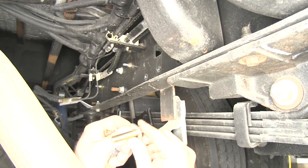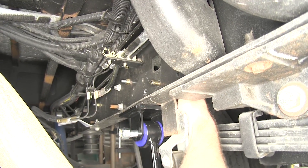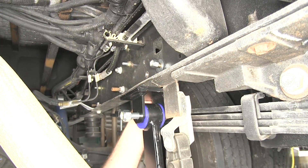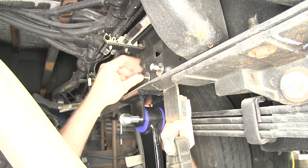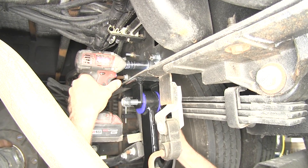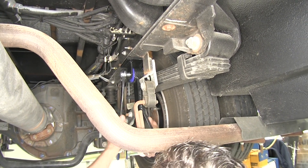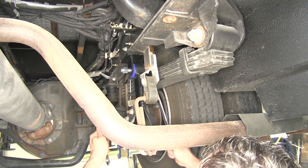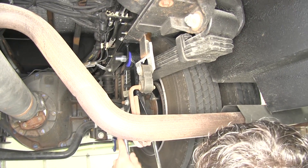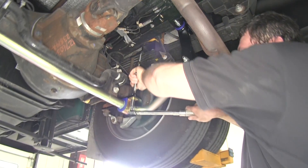Then we can take our 7/16ths bolt with a flat washer, place this bracket back up in position, then take another flat washer and a nylon lock nut. We'll do the same for the other bolt hole, followed by a flat washer and a nylon lock. We can take our 3/4 inch socket and wrench and run them down. Now we can snug up the ones that go on our sway bar links. You want to make sure you put these bolts with the nuts to the inside so you're not going to have any interference with the leaf springs. We're going to temporarily tighten these down — we're not going to torque them down just yet. Now that we have everything in place and snugged down, we can go ahead and torque them down to the specifications listed in our instructions.